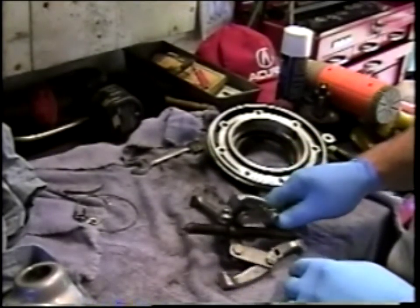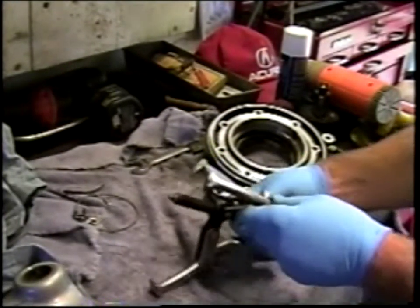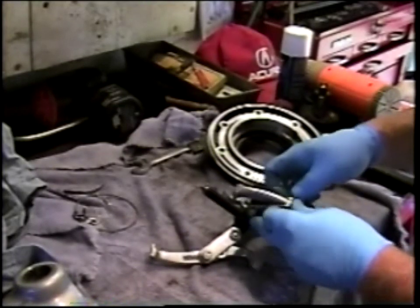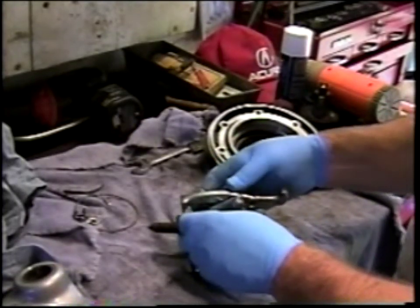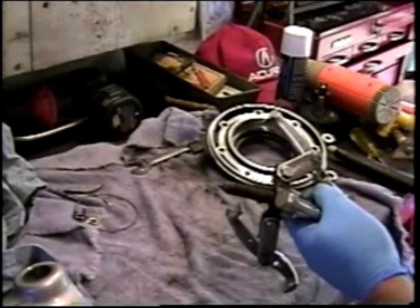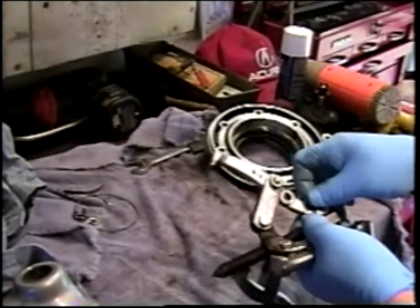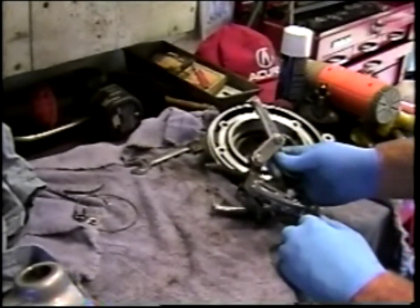I decided to put the crown wheel and crown wheel bearing assembly back in the oven to warm it up a little bit. Here's my bearing removal tool. It's a relatively inexpensive thing from a local auto parts store. Because there's a relatively narrow space between the outer race of the crown wheel bearing and the crown wheel gear flange, I've had to grind the teeth of the bearing extractor thinner on the bench grinder. If you compare the thickness of this with the other end here, you'll see that I started with something like this and have ground it down to about this. So shortly I'll go to the oven, retrieve the bearing, and see if we can pull those components apart.